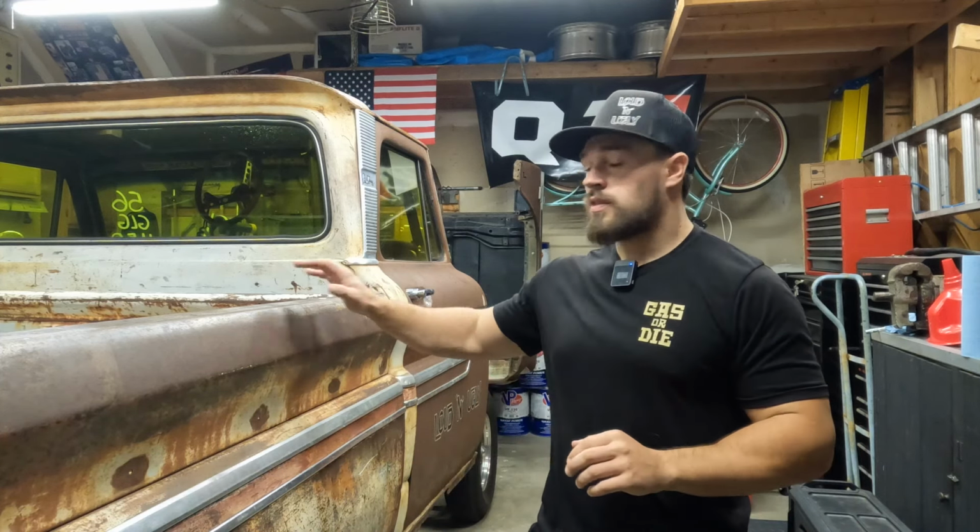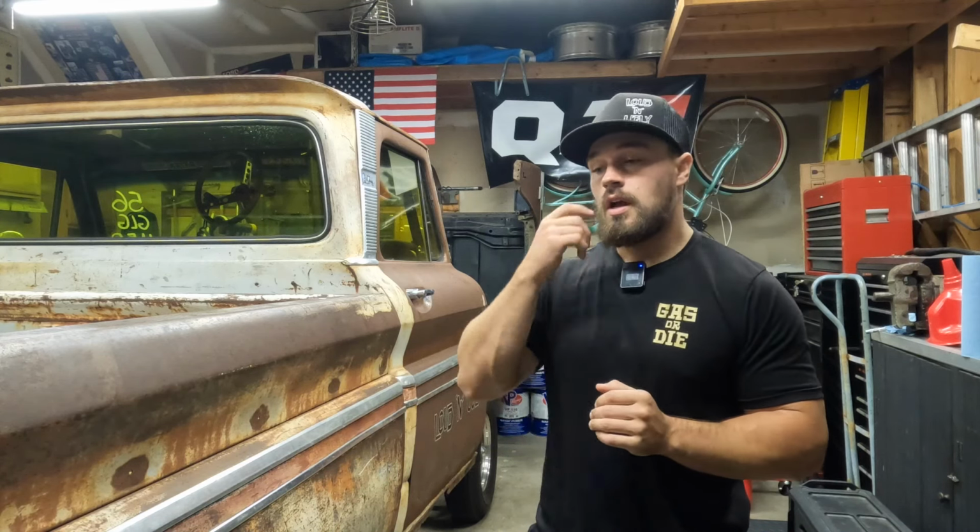With the race season being over, doesn't mean that we're done with Loud and Ugly just yet. I've got those ACP headers that I announced a sponsorship for a couple episodes ago, and we're going to be fitting the adapter plates onto these heads that I'm running on this truck. I got to do a little bit of porting on them so that they mash up really nice, and that way it gets a correct flow through the header.